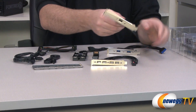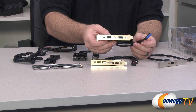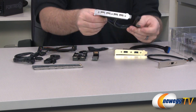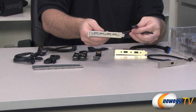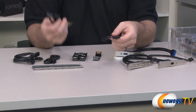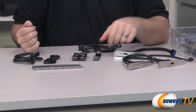The rest of the accessories includes a few PCI rear panel brackets. You get a FireWire one that you can put on the back of your case. You also get a SuperSpeed USB 3.0 rear panel bracket with two USB 3.0 plugs that routes to a 20-pin USB 3.0 internal header. You also get a little four USB 2.0 plug rear bracket with a couple USB 2.0 headers. You also get a couple power adapters — a Molex to 2x Serial ATA, and also a Molex to 3x Serial ATA converter, which is nicely sleeved. So if you don't have enough Serial ATA plugs, you should be covered.